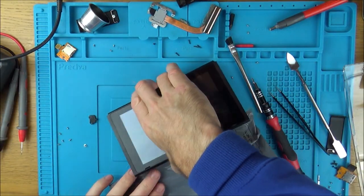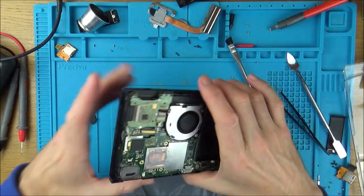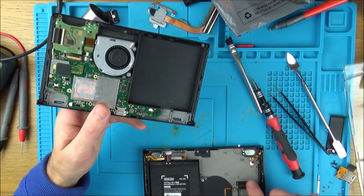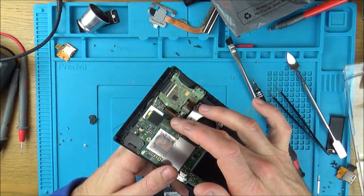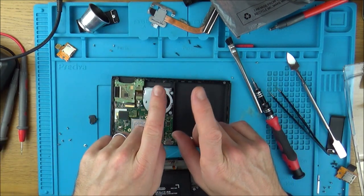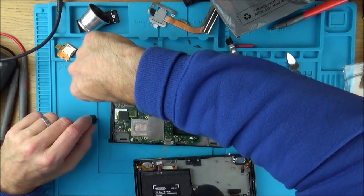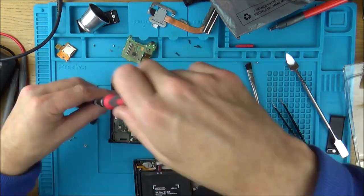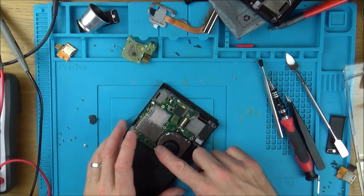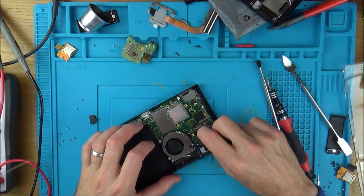I'm going to look into this connector as closely as I can to find out what's happening. I don't believe both screens are faulty — the odds of every screen plugged in knocking it out suggest it's a pin issue. I've had this before where a ground pin was shorting with another pin, preventing it from booting up. I'm going to plug the screen back in and check for grounds on the capacitors around this area — I'm pretty sure there was a ground on one of the capacitors when I had the faulty screen connector before.